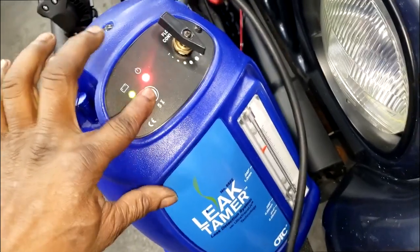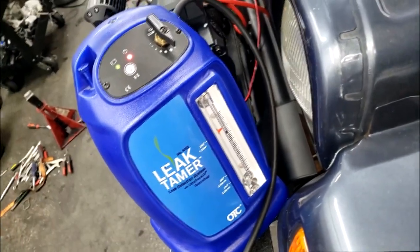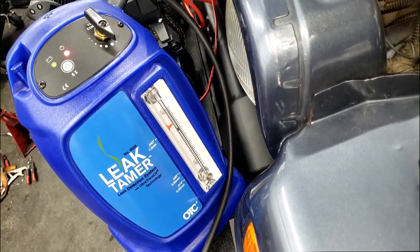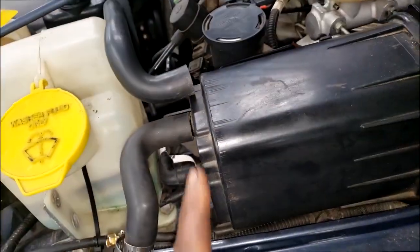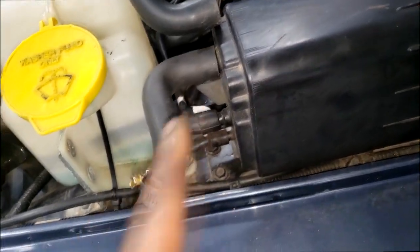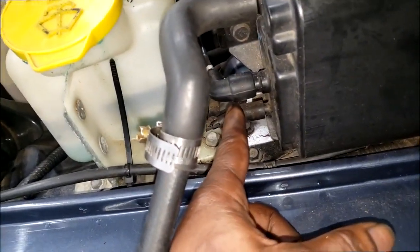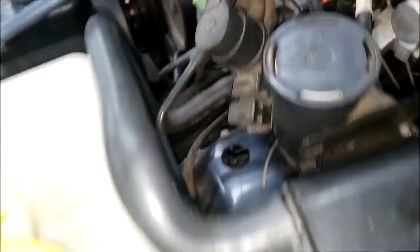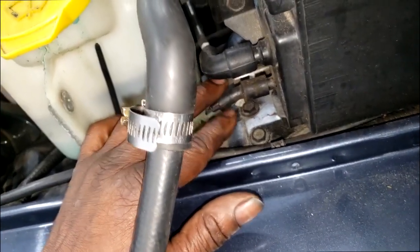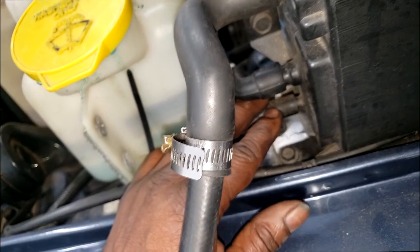I got battery supply going — let's click on, there we go. So right now it's filling the system up. It is trying to determine if there's an EVAP leak, and based on the fact that that ball is bouncing around, there is a leak. Now if you want to cut the system in half — this canister is accessible. I'm filling this up — whatever these two lines going to it are also being tested for leaks. If I had to guess, this big line is going to the purge valve. Let's trace it. It's essentially going to the purge, and the other hose is going to the rear — the fuel tank, the fuel filler neck, and all that stuff.